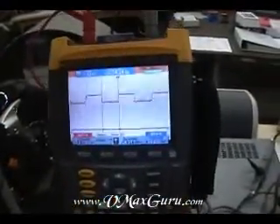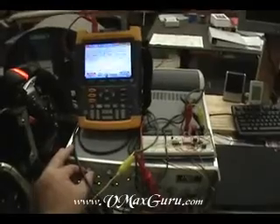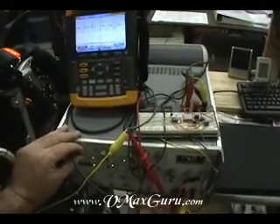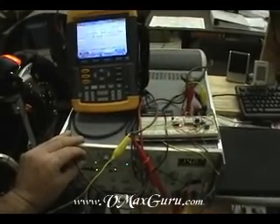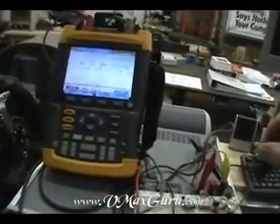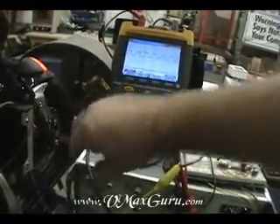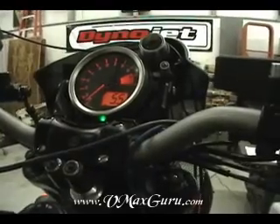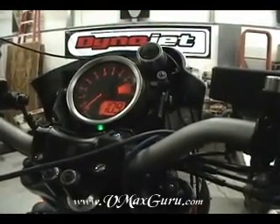The good part about this is you can watch a full view here — divide by half, then back off. Now this is actually working into the unit. The good part about it is a couple of extra pots. This is an adjustment pot so that, say, if I wanted to, I could make that drop down or increase it. Now the dividing point is at 110 mile an hour — it goes in to divide by half. The accuracy of this thing is phenomenal, and it does it precisely at that point every time.